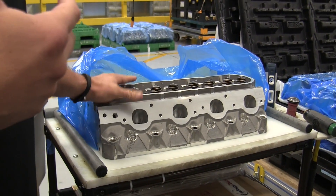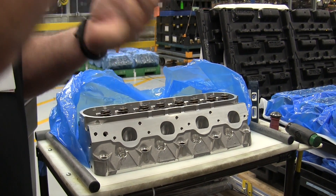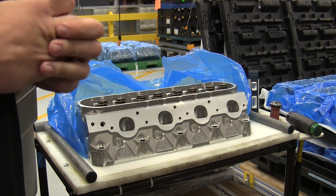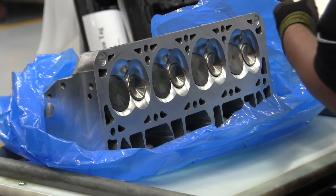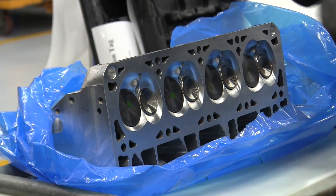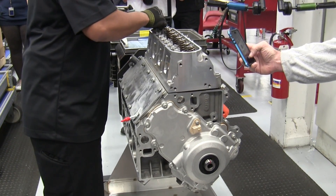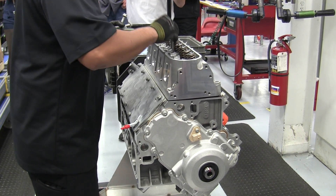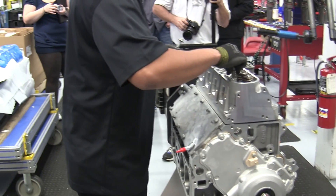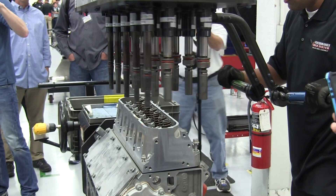This is one of the major reasons why we're able to get the power we do out of the LS7 — it's breathing, being able to pull air in and push it out easily. It has large titanium intake valves and sodium-filled exhaust valves to dissipate the heat — not a cheap item. Once each of the bolts are in place, they're all simultaneously tightened to maintain consistent clamping.